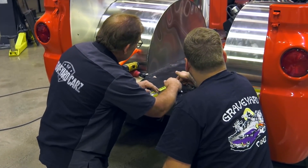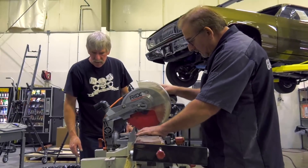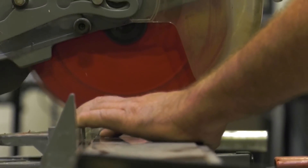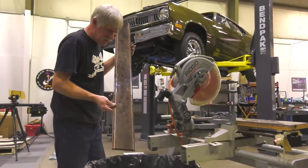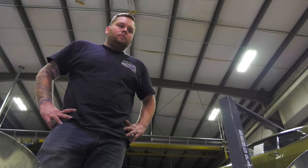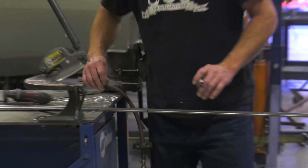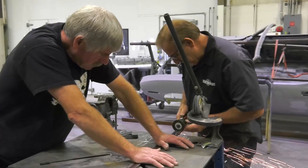The kit from Yogi's for the bed floor is for a regular eight-foot bed. That doesn't leave us a lot of extra wood and a lot of extra stainless. What we've got to be careful of is making sure that when we make our cuts, we don't overcut. You can't put wood back on. You can keep taking it off, but you've got to be careful. At the same time, if you've got a specific piece of wood that needs to be, say, 54 inches long but only four inches wide and originally it's a six-inch wide piece, then we have to do a radial cut or a lineal cut down. That's where guys like Royal come in because he's done a lot of woodwork. When you're done, you've got to stack this tongue and groove together with the stainless steel separators — they also have to be precision cut. You cut too far, you can't put it back on there.